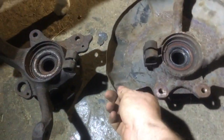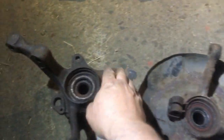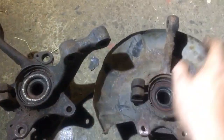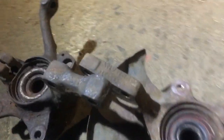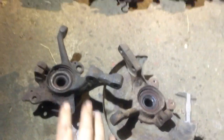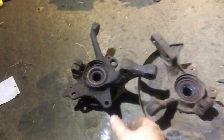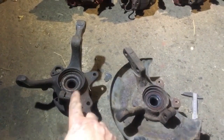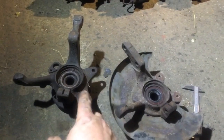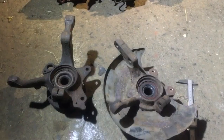The two lower points are roughly the same with no huge difference, but the two upper mounting points for the suspension have a big difference in height. So unfortunately you can't use Mark II hubs on a Mark I car — not easily anyway. You can get adapter plates to sneak on bigger brakes, but for this video I'm just explaining the difference between the two hubs.